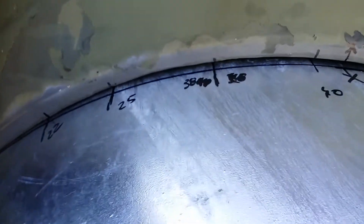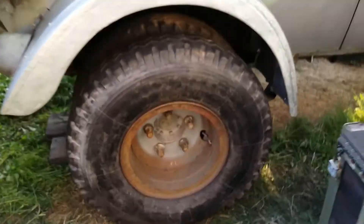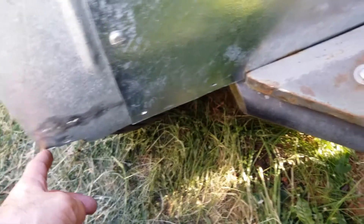But it's a work in progress, so I'll see how it works out. These are extremely rigid. They've only been bolted on at this stage with roofing bolts. I may put a few more in for added strength, and I might brace it across the top with a piece of angle iron just to make sure I've got absolute strength there. Similarly, on the rear end, I might put a piece of angle iron and run it into the wheel arch just to hold it in place. The front end I'm not too worried about — I'll remake this angle piece to come out either full width or at least half width. And same with the exhaust — I'll reposition that.